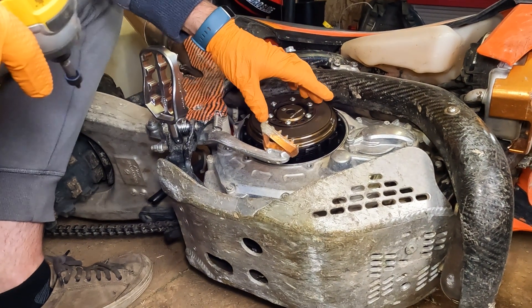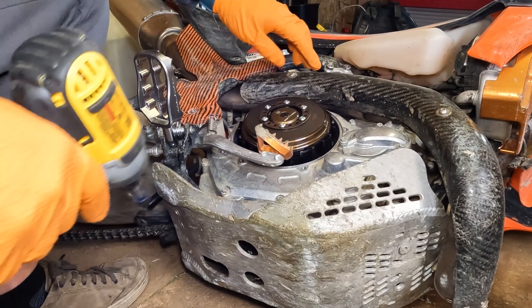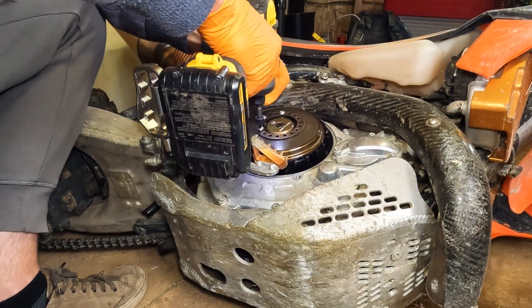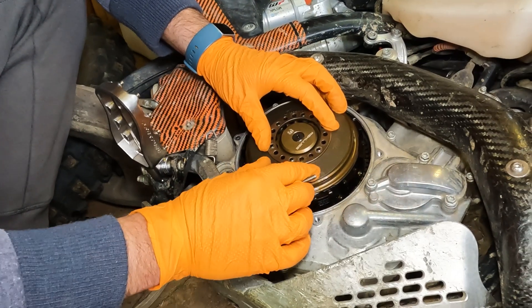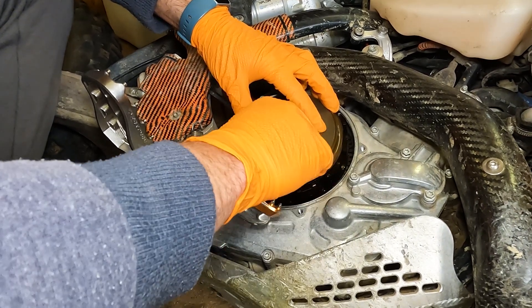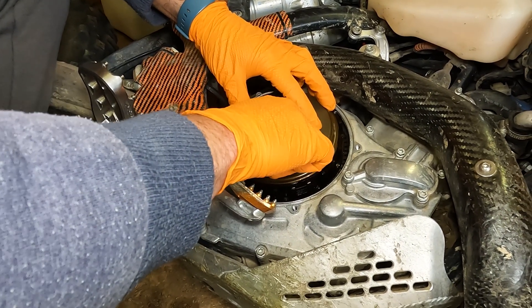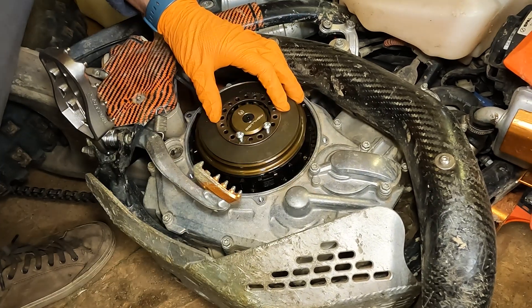It's already loose — unlike traditional springs, there's very little distance to go. I'm going to go from position three, just rotating this to two, and put all these back in. Not changing anything about the clutch stack, just the preload tension.